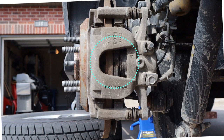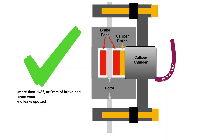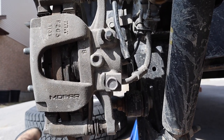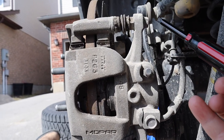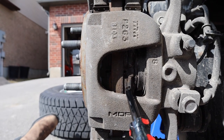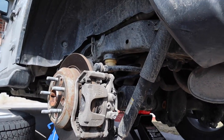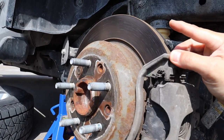Back to the image of the rear driver's side brake — I've put a graphic over it to highlight the caliper cylinder, the piston, the brake pads, the rotor, and the pins. If everything checks out we'll have more than an eighth of an inch or two millimeters of brake pad, even wear, and no leaks. We'll have a problem if we have less than an eighth of an inch of brake pad, uneven wear, or any leaks. The end of that screwdriver is about a quarter inch thick, and there's at least about a quarter inch of wear left on each pad.